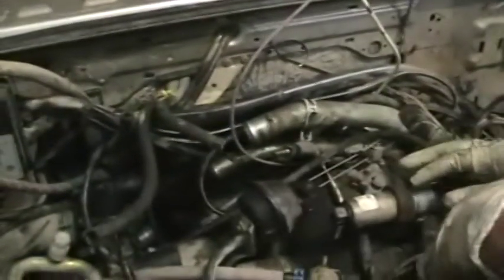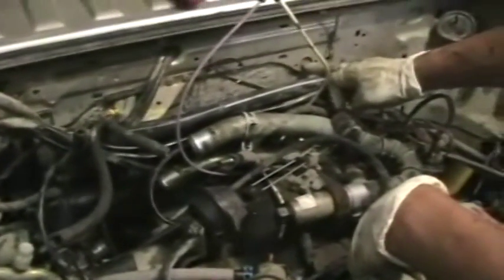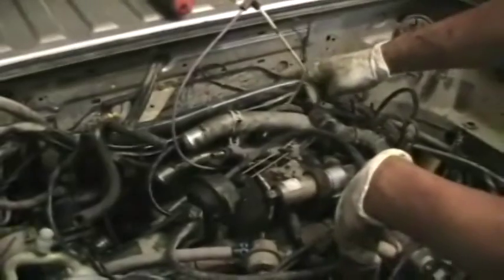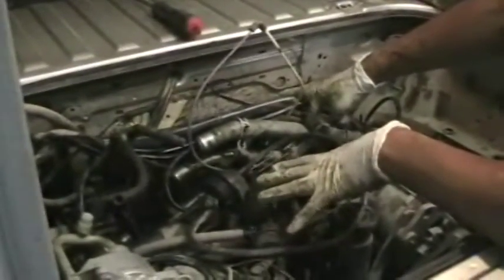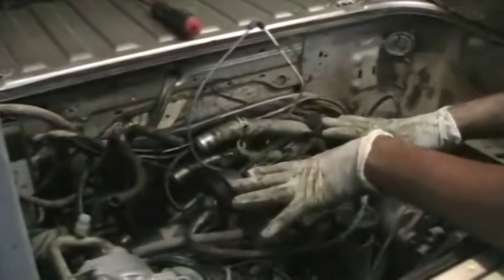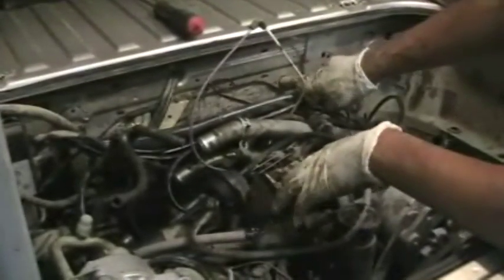On a 2-wheel drive van, in this area there's a plastic nipple. That's where you'll disconnect the fuel line. When you initially remove the engine, you'll leave that plastic piece. Once everything is out and out of your way, you can then go in and remove that plastic nipple.